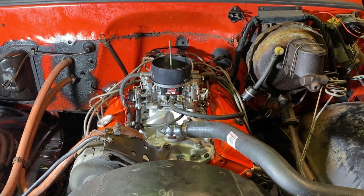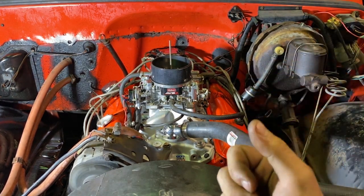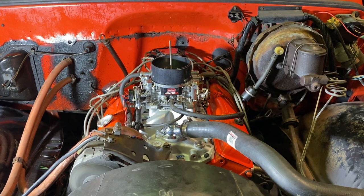They're definitely a lot quieter after that. I know that sounds like it's kind of hard on the motor, but the reason I'm doing that is because when you hold it at a little higher RPM, it brings the oil pressure way up. If it brings the oil pressure way up, hopefully it can pump up those lifters and shoot those springs back up, and then they'll pump up and it won't make any noise. That's why it made it a little quieter. As I was holding it there, it was getting better. I really want to get it out and drive it so I can get that oil flowing and hopefully it'll pump up.